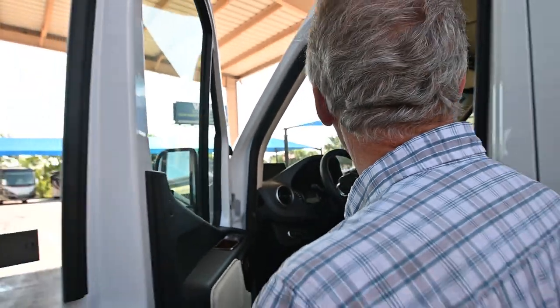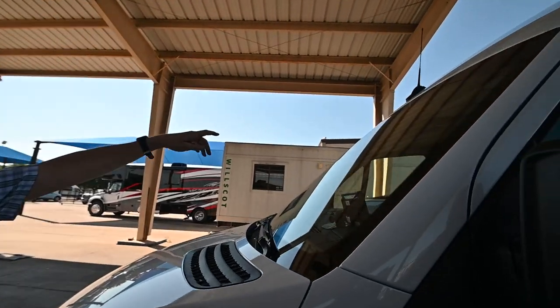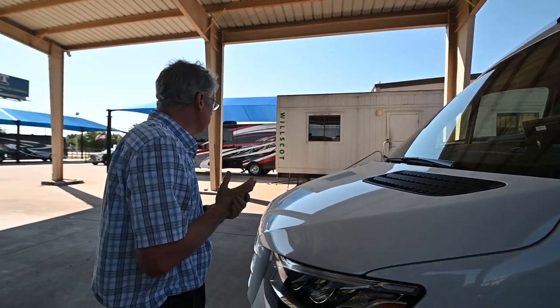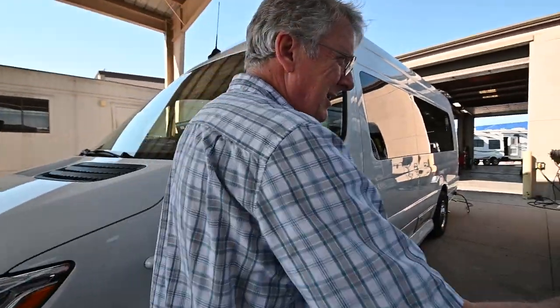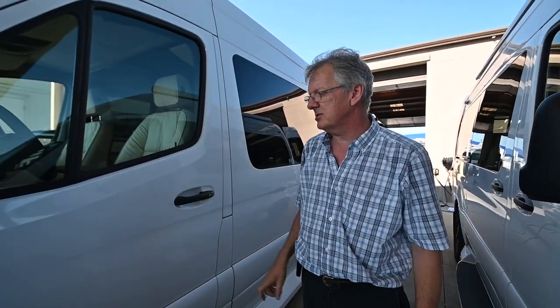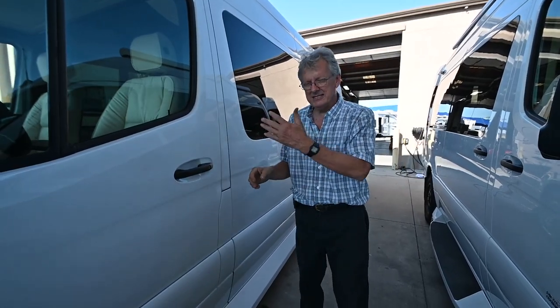When you're out on the highway and a car comes toward you, on the Midwest you'll see there's a camera mounted in the windshield that looks down the road. It's looking at oncoming traffic, traffic ahead of you, speed signs, and the white lines on the road. That allows all the safety features on board to work with the sensors. We have lane keep assist and driving assist — when you're in cruise control behind traffic, it will maintain the distance from the car in front of you.